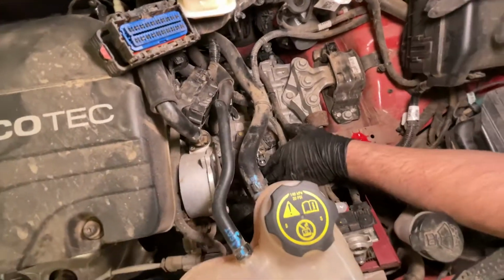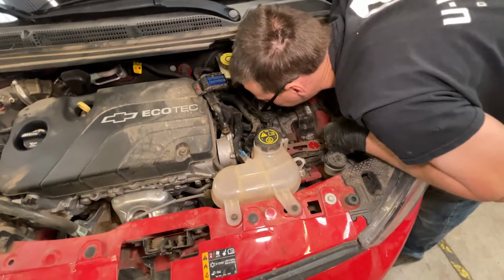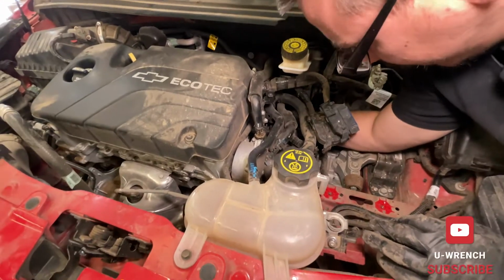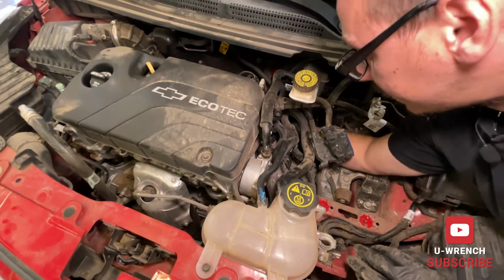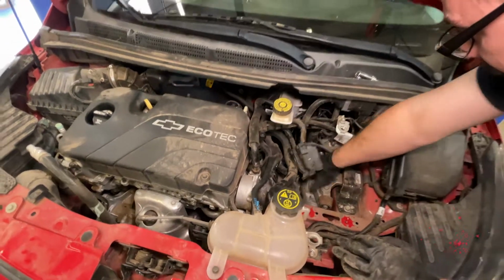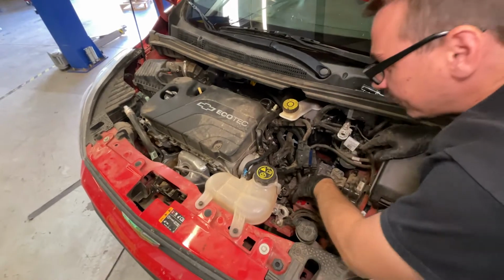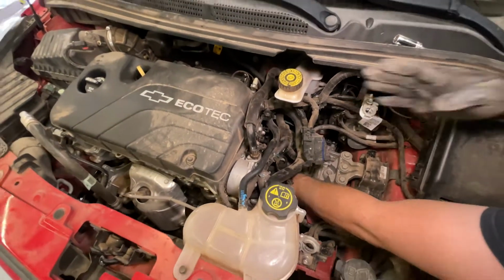I'm gonna take off the shift selector, unplug some of the sensors. There's a few of the mounting bolts that'll be kind of terrible to get to. So way back down here is a nut, which I'm guessing is a bolt that goes through from the backside under the intake manifold. I'm gonna have to figure out what I wanna do to get that bolt out. The other 2 that I see up top are decently easy to get to. They're also hard to see with the camera. They're just underneath the head. There's one on either side.